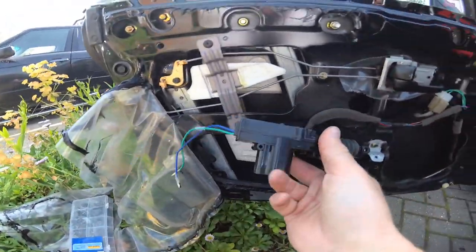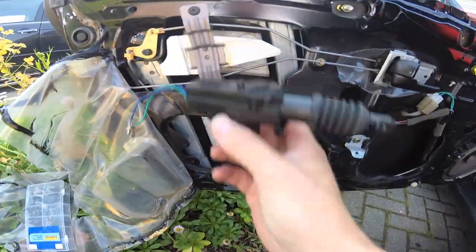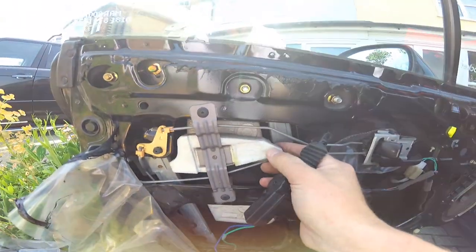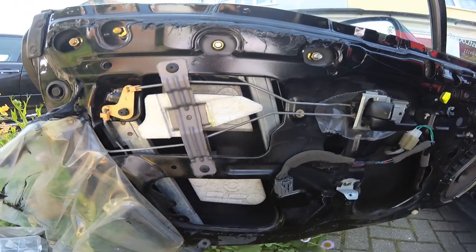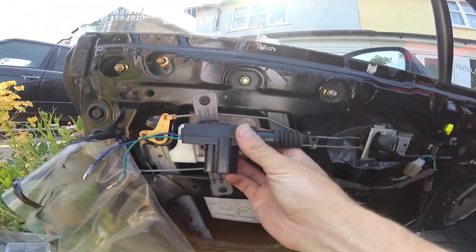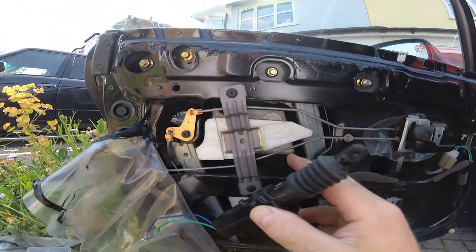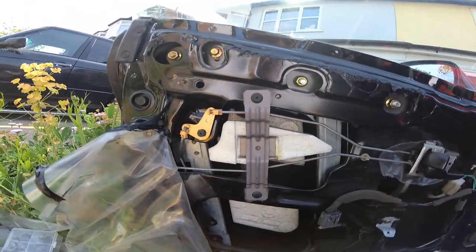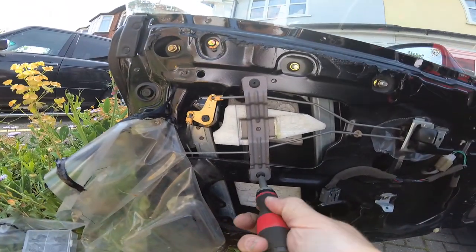Here is one of the actuator motors. On my MX-5 there's this bit of polystyrene with a bracket, and that is where we're going to be mounting this - in that position there. This is actually where I think the factory central locking mechanism is positioned, so this is kind of a blanking piece for models like mine which, back in '98, were too poor to afford the central locking option.